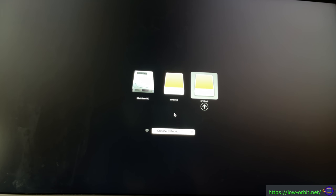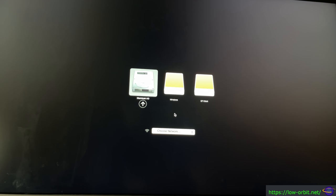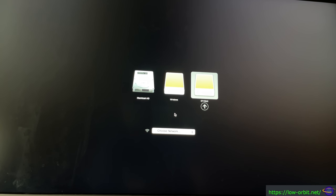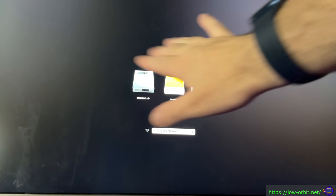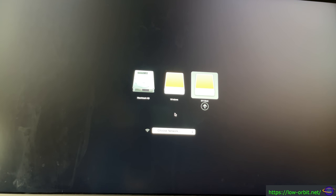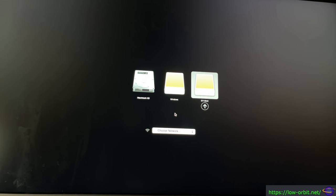I'm going to go ahead and try booting off of the USB drive. So this is our hard drive — this would boot into Mac OS or at least the Mac OS installer because it's been factory wiped. There's a Windows partition and an EFI boot partition — those are both on my USB drive. I'm going to try booting off of the EFI boot. Looks like we got the ESXi loader installer going — you can just barely see it. It's loading a bunch of modules and we're just going to have to wait a little bit.